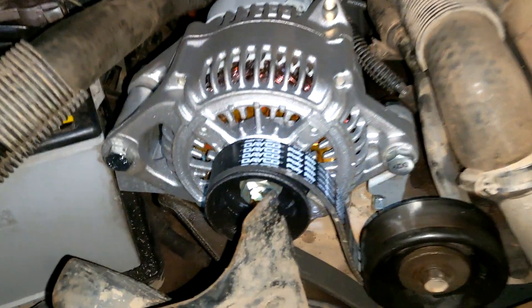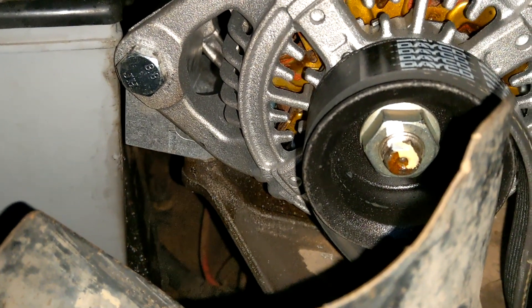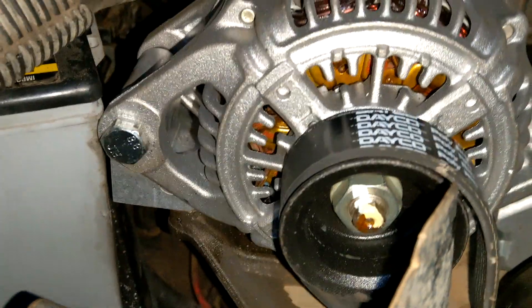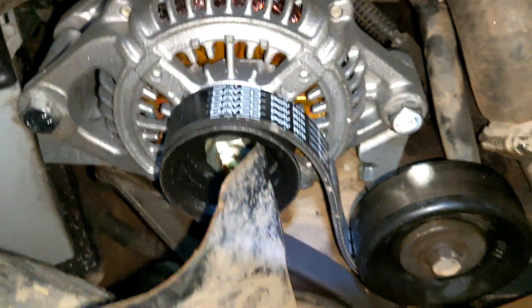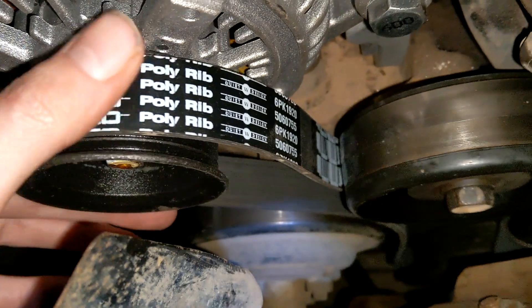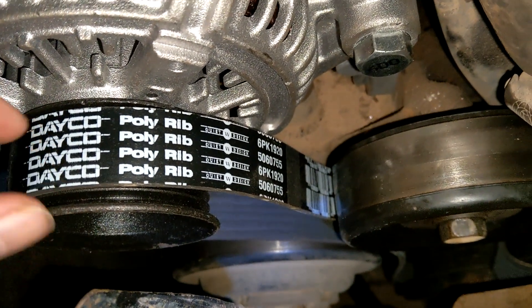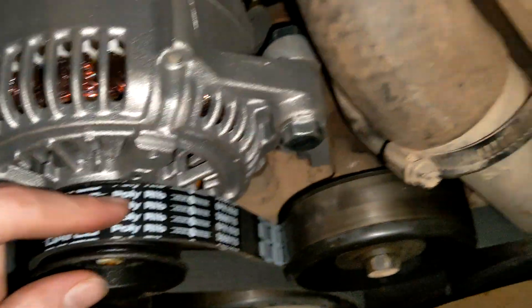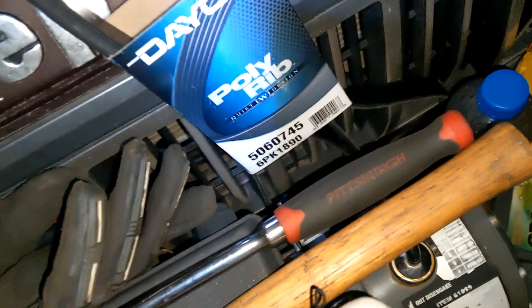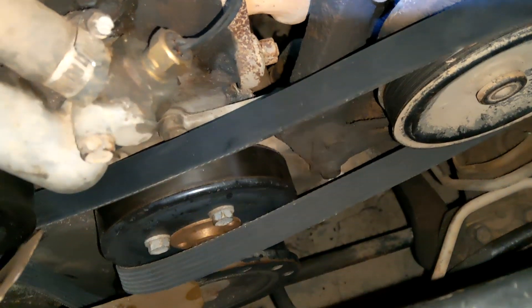Update - it's a lot later now. We tried getting that stud out with no luck. Tried welding nuts to it, tried drilling it with EasyOuts but they would catch and then instantly shear out of the hole. For now we're just going to run it as-is with just the rear bolt - the belt tension will pull down the other side. That bolt is tight and this bolt is basically tight so everything lines up pretty well. Fun fact: this is a seven-rib pulley from the Grand Cherokee. The 75.5-inch belt was too short - if you measure 76 inches you need 76.